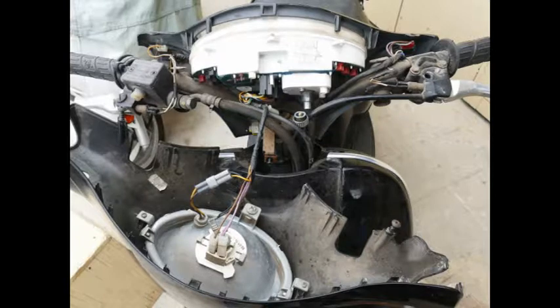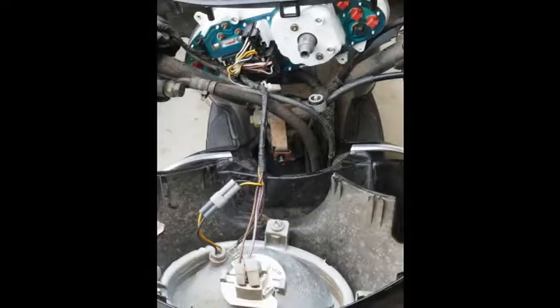Starting about 30 years ago, most automobiles switched to using a synthetic boot that keeps electrical connectors free from corrosion even after more than 20 years. But Vespa is not alone — most motorcycles still use these old connectors, which get corroded and cause electrical problems. The solution is to take each one apart and brush in some silicone-based electric grease, but there's a risk of damaging connectors. The horn, signal lights, headlight, and even the control module all have a connector.